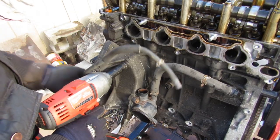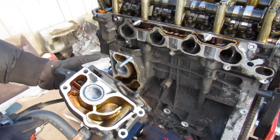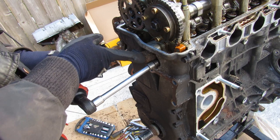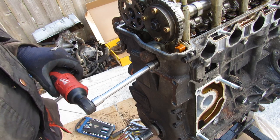Removing the nuts that hold the water pump housing on, you can see it also looks like it has some oil passages inside — that's for the PCV system. Now this here is the valve that controls the cam phaser, called the VTC valve. Sometimes some Hondas have issues with this — it needs to either be cleaned out or replaced. I've got another video on how to replace this on the vehicle, linked in the description below.